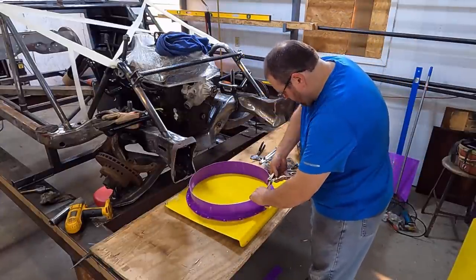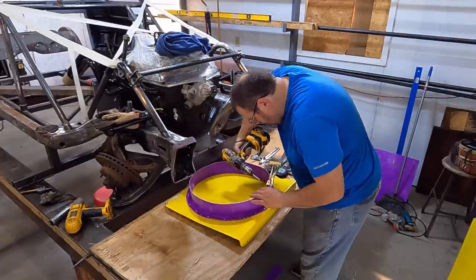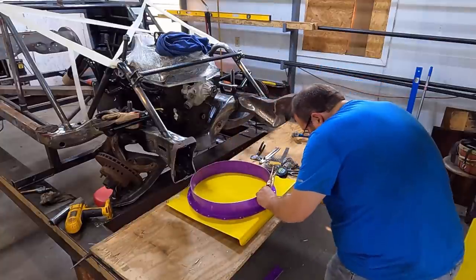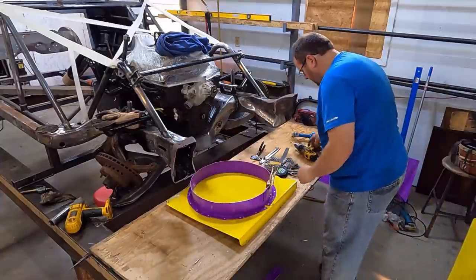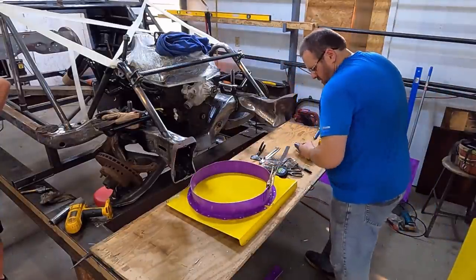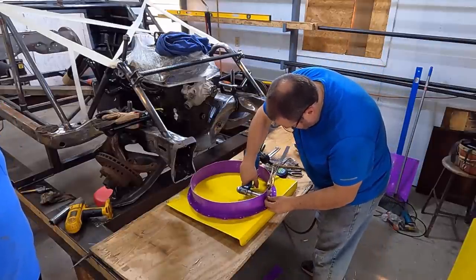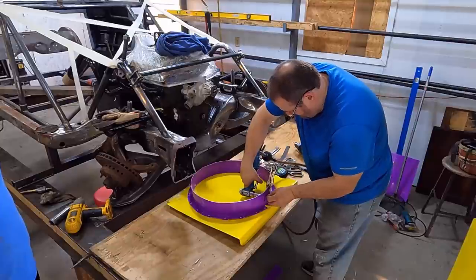And then on this front right here, I'm just gonna clamp that together. I overlap to the outside, and I'm just gonna put these two rivets right here. So we got a cuff, and we're gonna put these in with them facing outwards, and we're gonna put a backer on it, just like that.